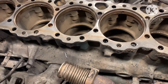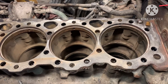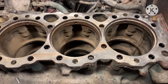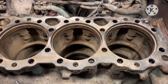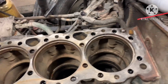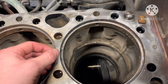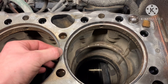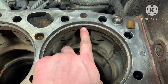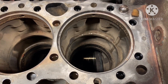What happens is, even with the smaller cracks, it'll let your liner drop down some — not much, just a few thousandths. The spec is zero to three thousandths, but when they drop down you'll start having head gasket issues because you don't get a good clamp on your firing ring. These cracks here are a little too large — bigger than what we're going to be able to take out with a 60 thou shim, which is the max shim you can go.